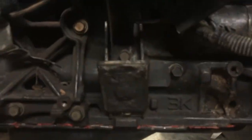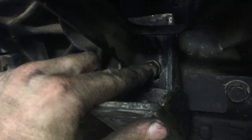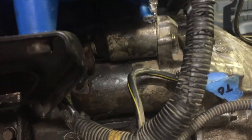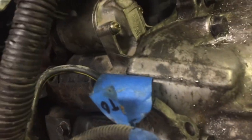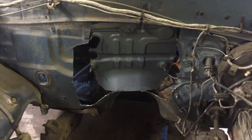The engine is pretty much ready to go back in. I decided instead of chopping the mount, I just chopped a little bit of the support bracket for the intake manifold — should be fine, and that way I have both the bracket and the mount. The original hole for the mount was up there and I had to drill one way down at the bottom, but it looks good. The bottom mounts are ready to go and the other side is all good too. The starter — I trimmed out the edges and fit in the DSM starter; the flywheel is also DSM so hopefully it works, though it sits in a different spot than it did on the front-wheel-drive transmission. The engine is pretty much ready to go in, but obviously first I need to fix up the firewall.